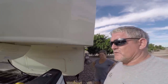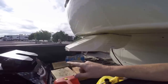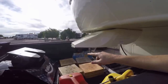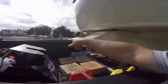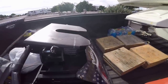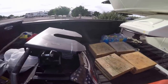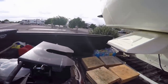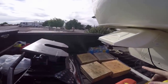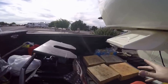What Kim and I are going to do is hook up Maddie to the truck. We're going to bring the truck back to where it gets close to the kingpin and get leveled up. Now the front of this right here should be right on that white line or right inside the catch — and that should be touching that white line. That's what's recommended with this rig for how to set this up and hook it back up. So I'm going to bring it back, Kim will get me where I can stop, and I'll lower or raise it however I need when I get a little bit closer.